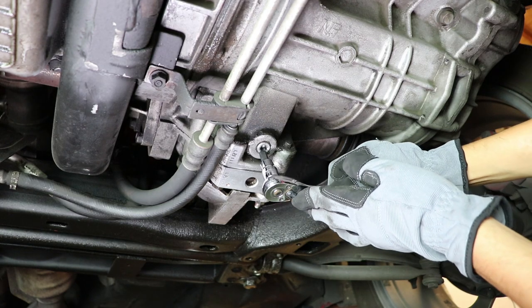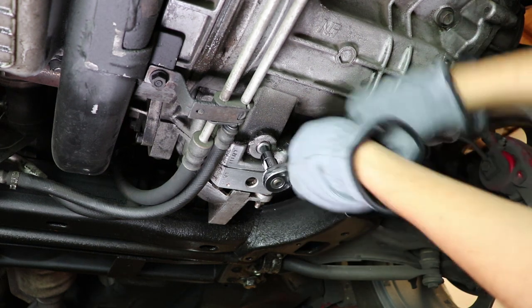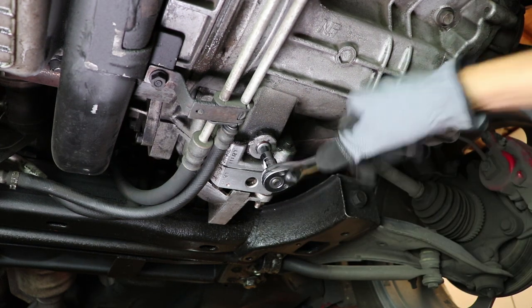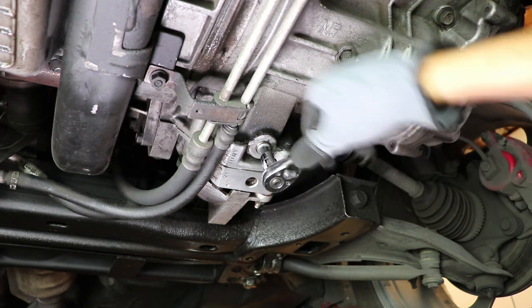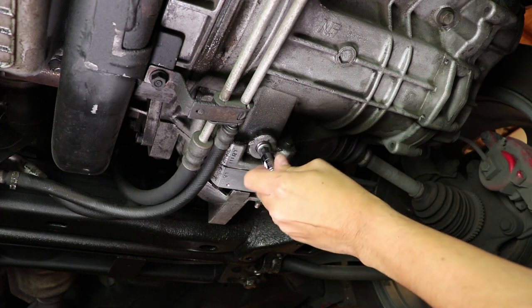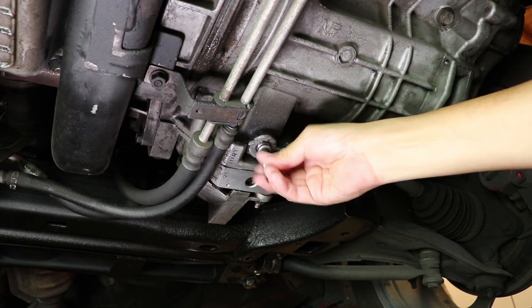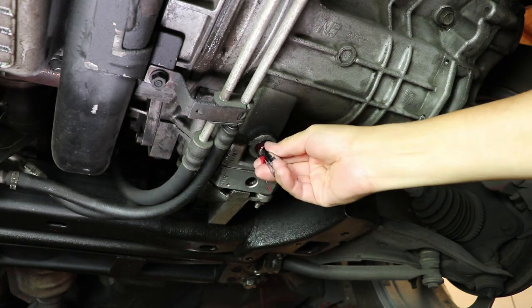The first order of business is to drain the transmission fluid. However, draining the fluid is only required when doing the driver's side axle. When replacing the passenger side axle, no fluid will leak out. The other way to get around emptying the fluid will be to lift the car very high on the driver's side, so high that when you pull the axle out, no fluid comes out.